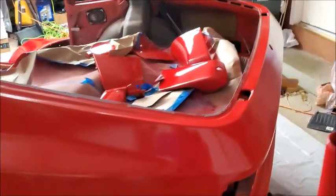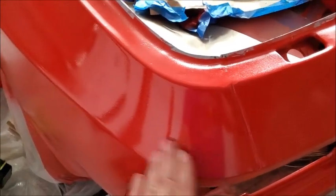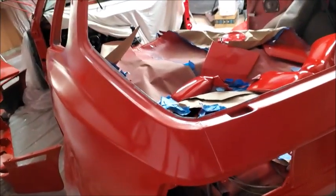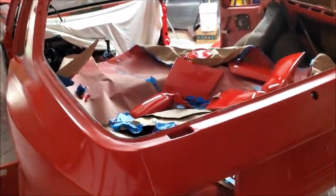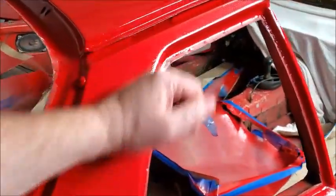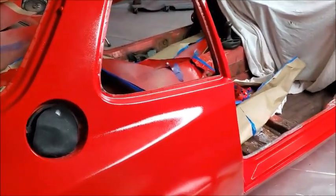But I have a feeling it's just going to get right to the paint real quick, because there just isn't enough clear coat on it. But we will see. Like this corner is smooth, because I was going this way, and then when I came this way, this got more on it. So anywhere I overlapped, it's good, because there's enough clear coat on it. But anywhere I went straight, I just went too fast and didn't put enough on. So we'll just start sanding it down and see what happens. Bummer.